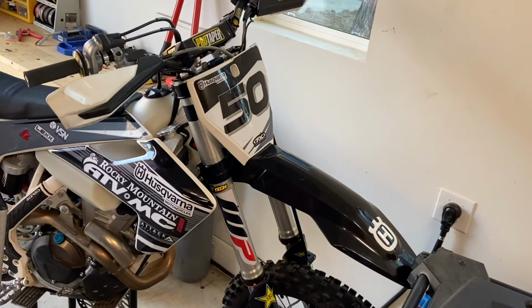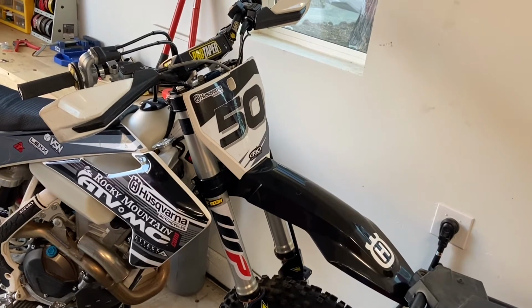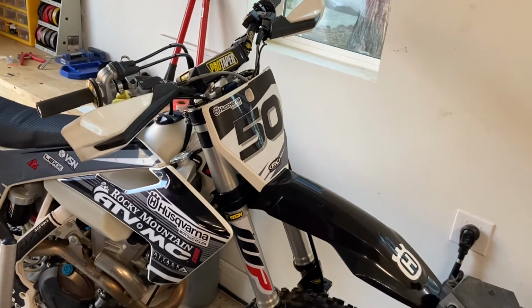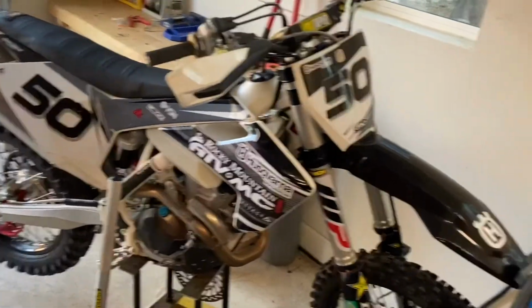Because you can get them wrong, you can shim them wrong, but pay attention to detail, get a good micrometer, measure it all out, take your time with it, and don't overthink it. That was my problem, I was overthinking it. But yeah, good performance. I liked them. I liked them enough to the point where I'm going to get it for the rear and try it out.